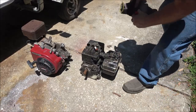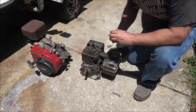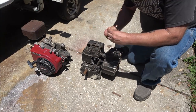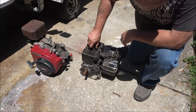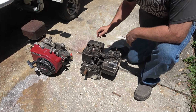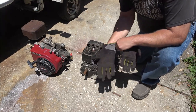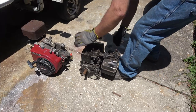All right. Okay, guys, so I grabbed the spark plug out of that orange motor because we know it's good. It's actually sitting on the mini bike right now. I put it on there and hooked it up. This does have good spark right now. But I think before, if I remember right, we were getting spark sometimes. I know that's not tight, but... Alright. I don't want to get shocked real bad. So, yeah, if this fire's over, we'll put some gas in the tank and see if the carburetor is going to work. Let's choke it.